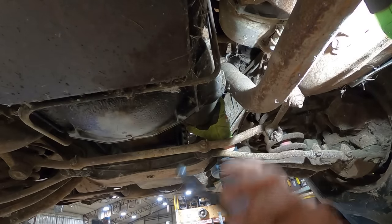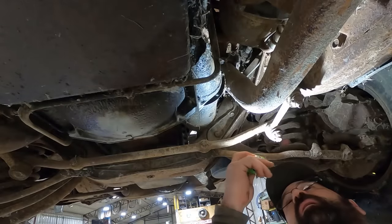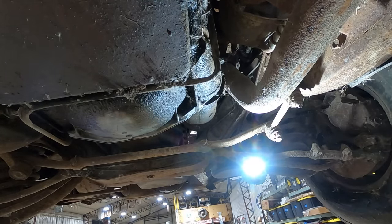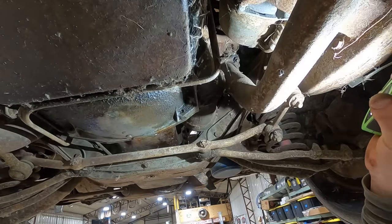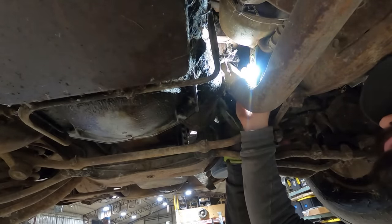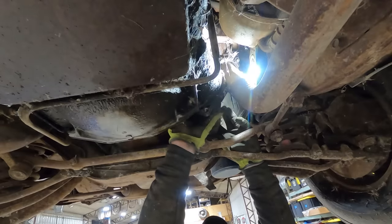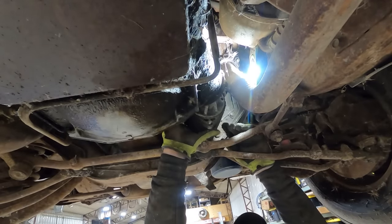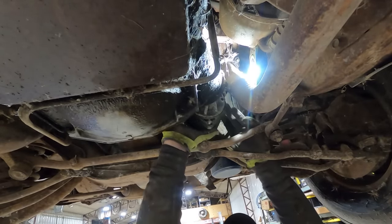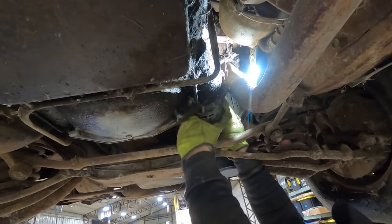You got that wire loose up top, so it should slide right out because it doesn't have headers. Usually only two on ones I've worked on. That one's for the bell housing. It is moving, so. There you go. Just an interference fit. Yeah. Oh, you gotta pull the motor out though to get the starter out. Not funny.